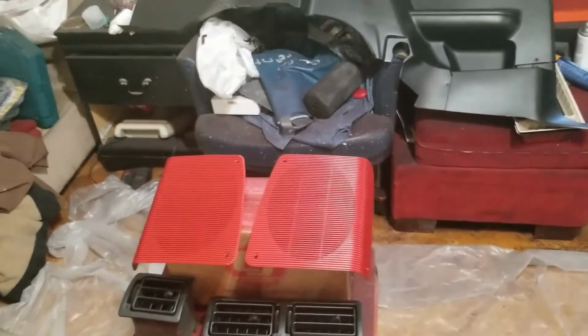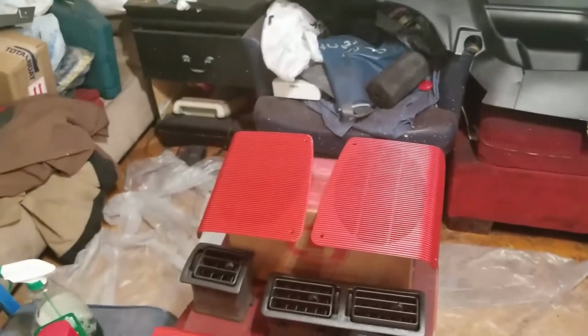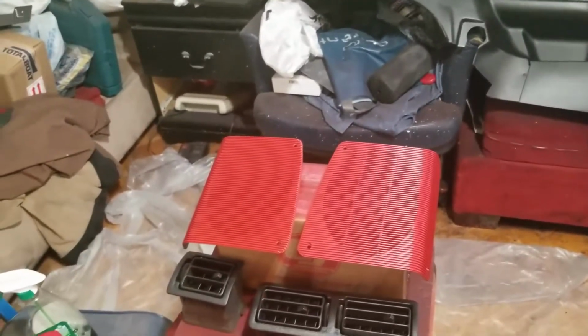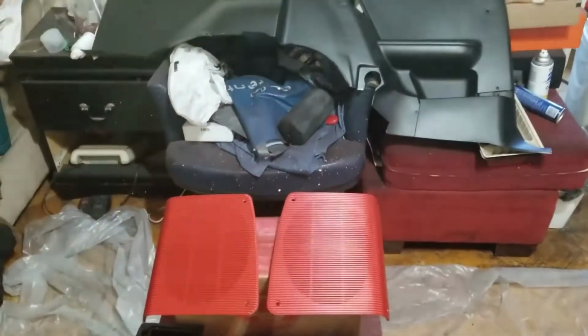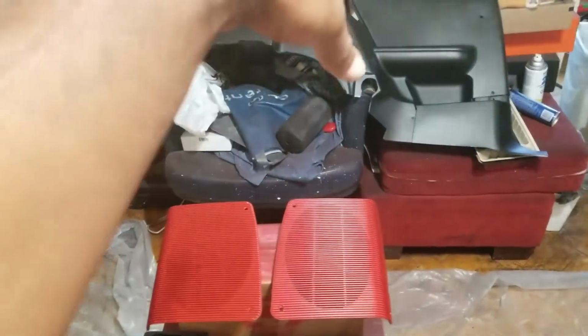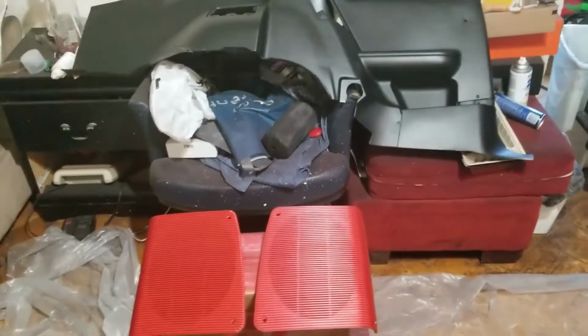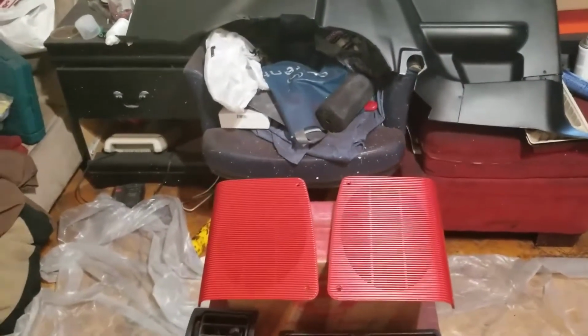And just use the old ones for whatever purpose I like to use, whether it's to soak up water or whatever, and use the old ones for that, then use the new one on what I'm about to paint. Okay? Believe me, it's going to save you a lot more time, because if you get a fish eye, you're going to have to do that whole thing all over. And trust me, it sucks. So just use a brand new microfiber towel. It will save you time.